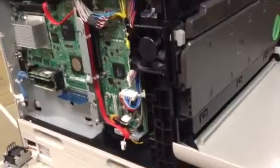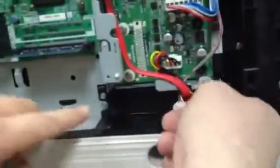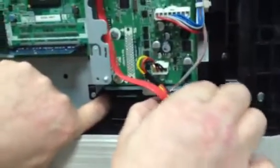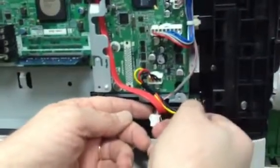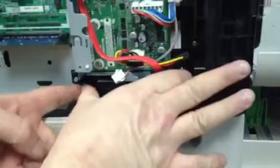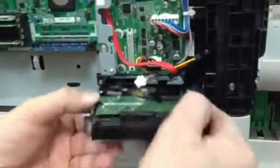Now we're down to the hard drive. The hard drive is under here. What holds the hard drive in is this lever right here — there's really nothing on the hard drive that's easy to grab. The easiest way is to grip this cable connector right here, then wiggle and lift the hard drive. Once it's popped out a little bit and free from that retaining lever, carefully disconnect this black connector and move it up out of the way. Now you should be able to get your hard drive removed, though it is a tight fit.